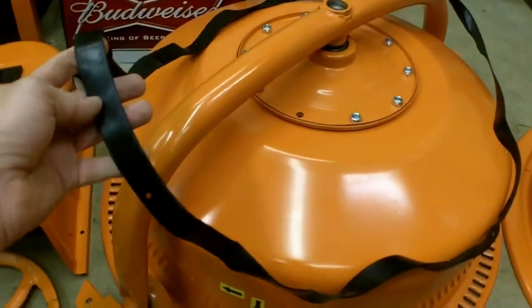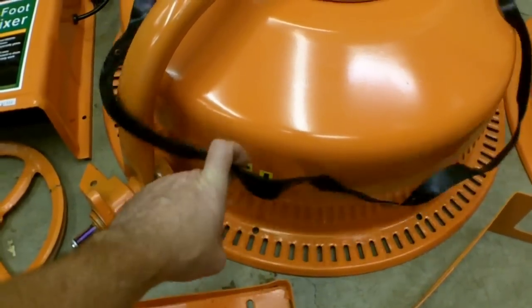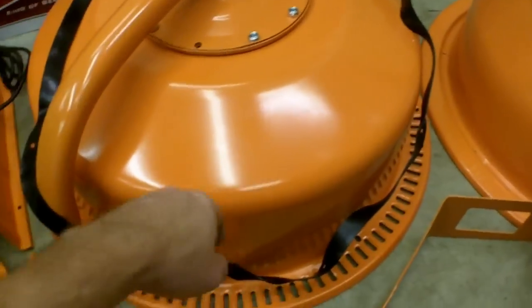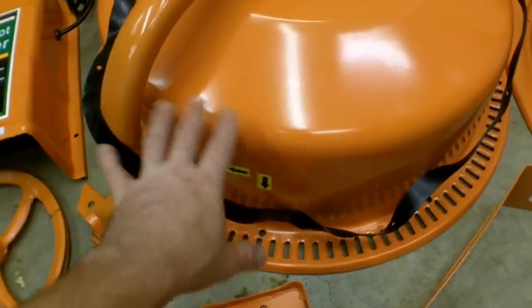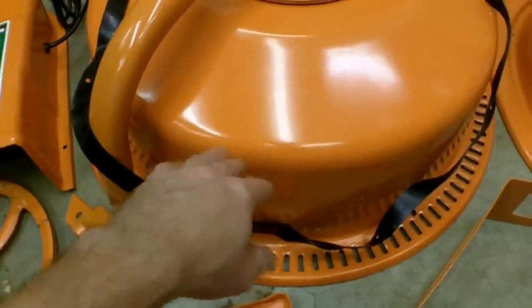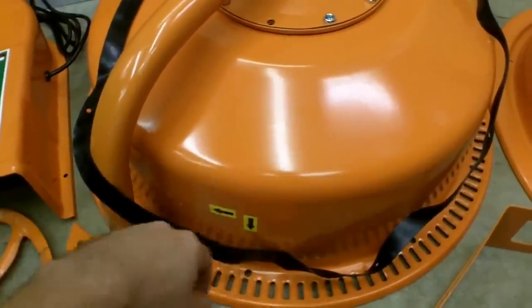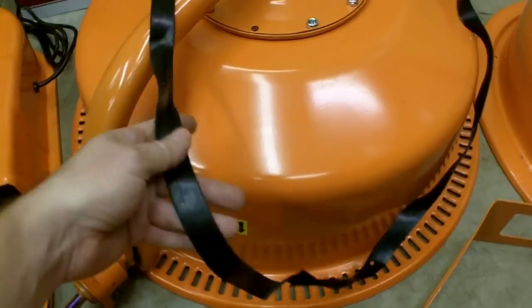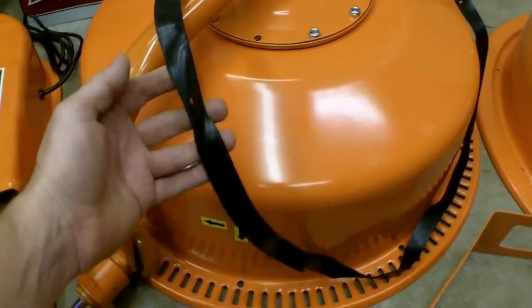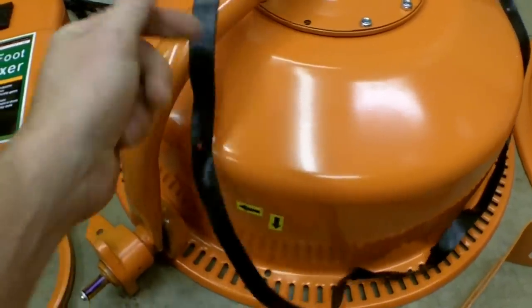Since I don't know if I have sealer — you have to provide your own sealer to seal the gasket between the two drum halves — I think once I get it assembled I'll put it together dry, snug it up, let it sit overnight, then take it back apart and seal it. Or, if it's that big of a deal, I might get at it with a heat gun and just flatten it out. They've literally just cranked it.